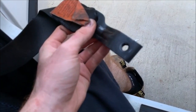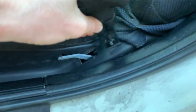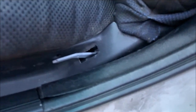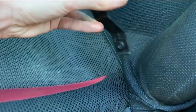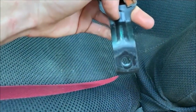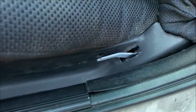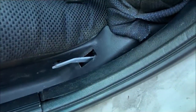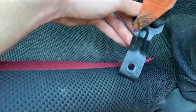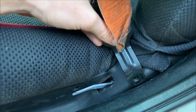BMW has their seatbelt going to the chair. Now, this is easily doable. I will have to make a slot in the trim, and I will have to make a hole to take this M8 by 1.25 nut. That's all they've given you. So I'm assuming it's nothing that takes too much load, just a regular automotive grade tensile M8 1.25 bolt. Actually, what I could do is make the bracket, as in the chassis bracket, have a little tab come off it to take this. Actually, that might be a better option. However, if I do that, it might be super weird and it may not fit the seatbelt right.